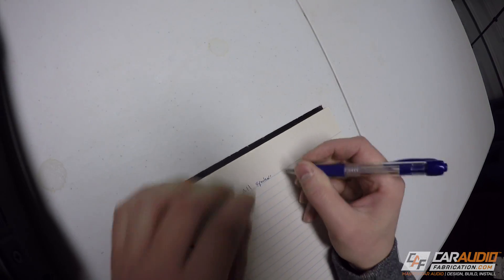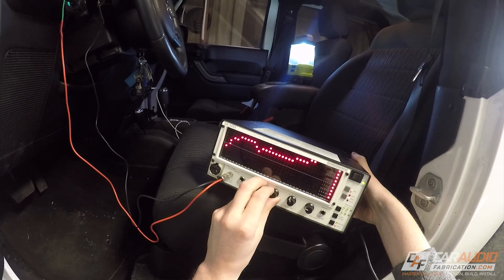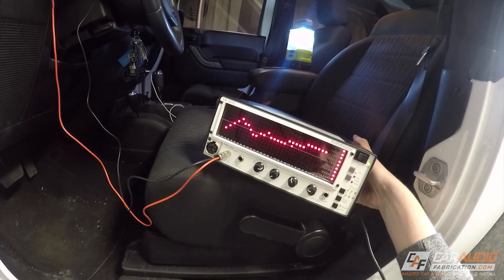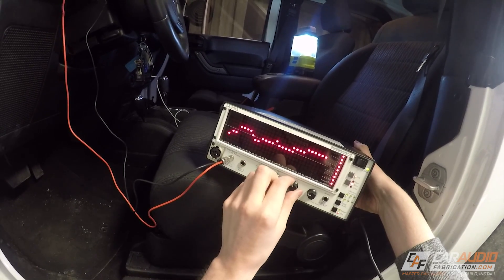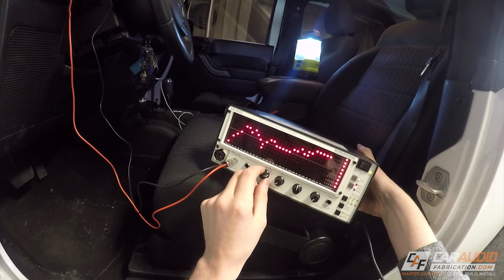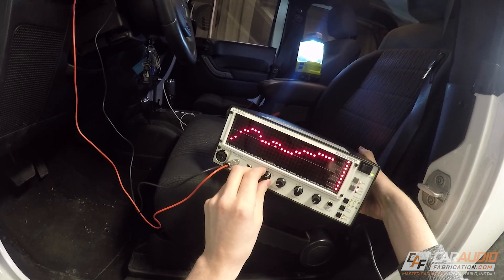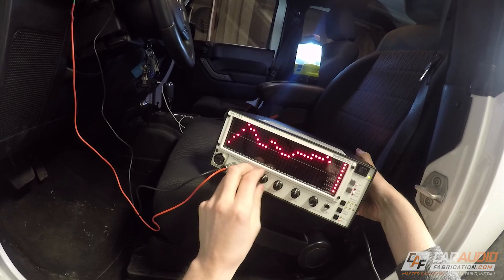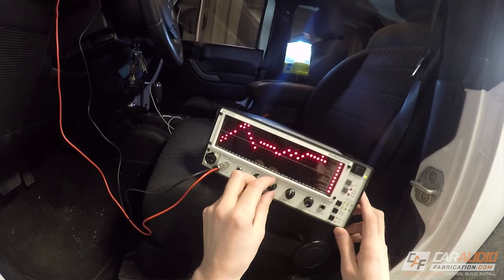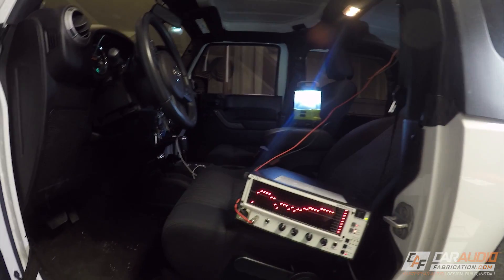As I'm doing these steps I will write my findings down so that I can check them easily later. Next up I'm using an AudioControl RTA to look at the frequency range and response of the electrical signal. The wires are currently connected directly to the speaker wires, not a microphone, and I'm playing white noise. This allows me to see the frequency range of output from this particular channel of the amplifier. This signal is relatively usable but it does drop off in the bass frequencies and has some other valleys and peaks that I would like to see corrected. This tells me that to make the system sound best I'm likely going to need a digital signal processor unit or another form of equalization. I test all the channels of the factory amplifier and found that this is the case on them as well, and I take pictures to refer to later.